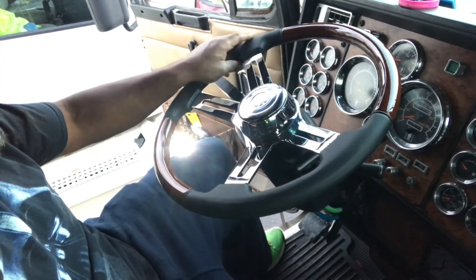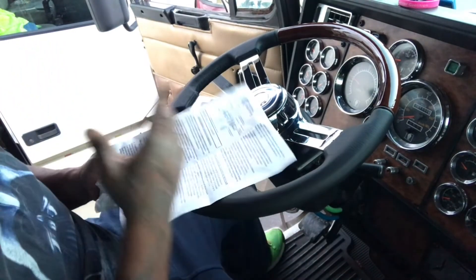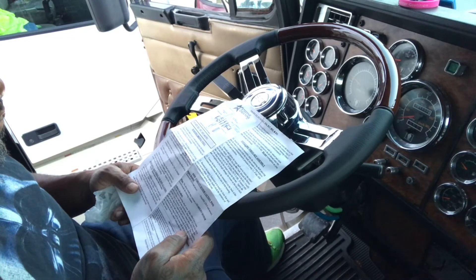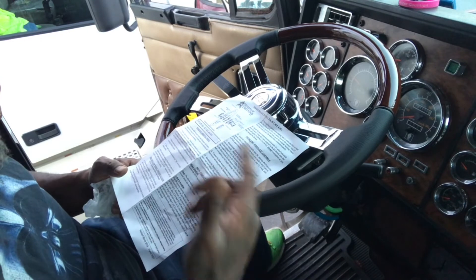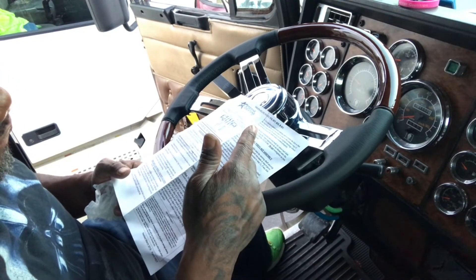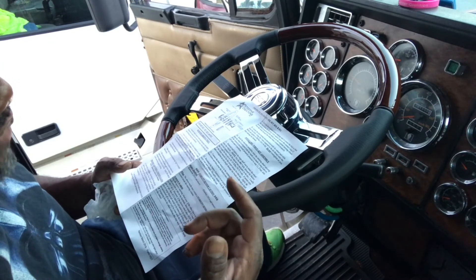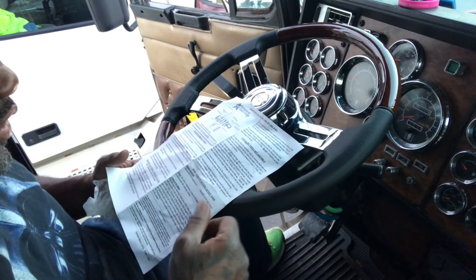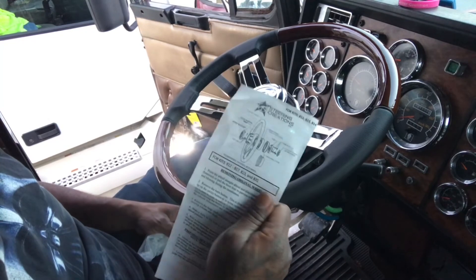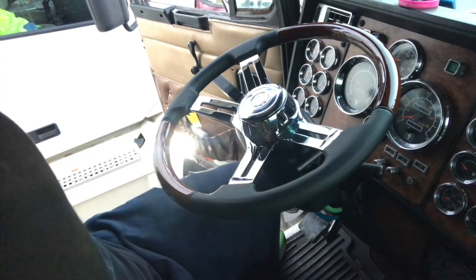All I've got to do now is put the wood steering knob on. It's not too bad at all. You can torque it down — the specs are 50 to 55 pound-feet for the nut. I might come back tomorrow and torque it all down the right way. Check your shop manual for proper torque specs, and do not over-tighten the nut. Make sure y'all like and subscribe to the channel. This is DIY Trucker Jay — how to put in an SCI Steering Creations steering wheel. You don't even have to go to a shop to get the steering wheel done. Thanks for watching. Peace.